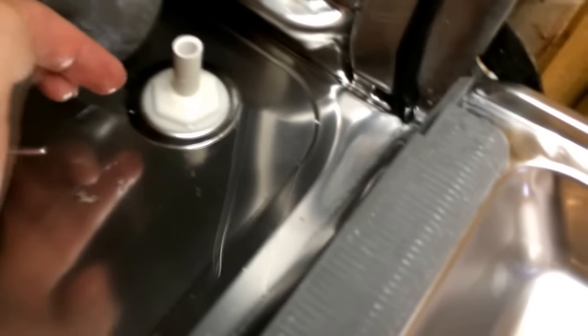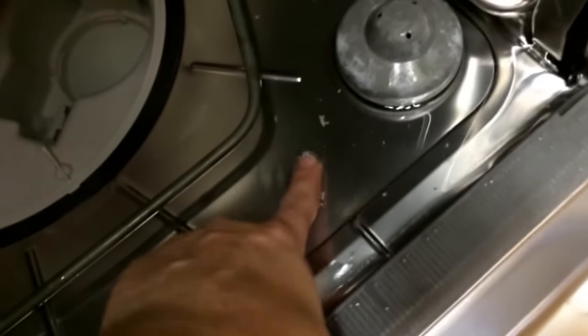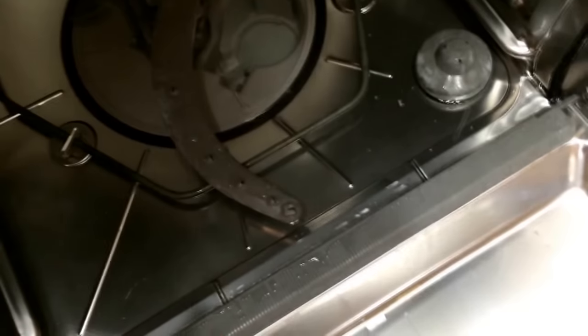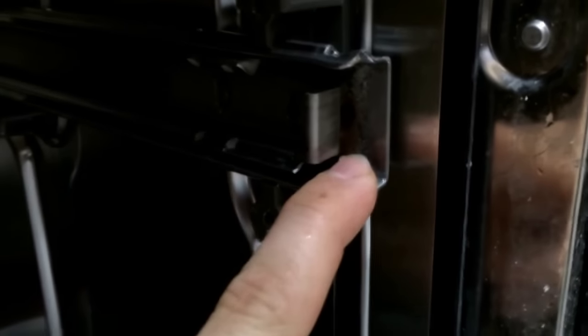Make sure you get along these edges here — there's all kinds of gunk and junk that stays in those edge corners. As you can see, this is some of the stuff that comes off after cleaning, and I'm still running cycles and there's still stuff coming out. I don't want that on my dishes — that's bacteria. I've pulled the filter out to clean it, pulled the tray out, and I'm doing wash cycles followed by drain cycles to suck it all out. I'm almost at the point where I'm going to pull this thing outside and power wash it to get rid of the remaining scaly buildup.